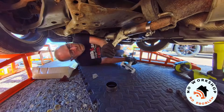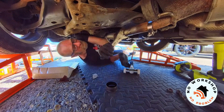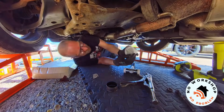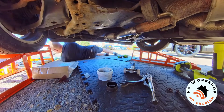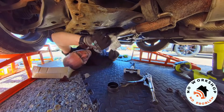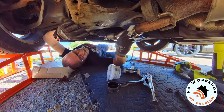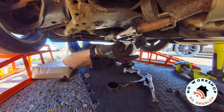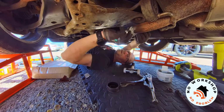All we needed then was just a little bit of fine adjustment with a pair of vice grips and a big hammer, just to bring the two pipes nicely together, before finishing off with a generous application of gun gum all over the joint that I just made there. Now, I do accept I should have put the gun gum on before I put the pipes together, but trust me on this one, these pipes were such a tight fit, I was scared if I'd put any gun gum on before I tried to put them together, I'd never have got them together.